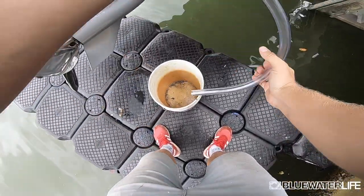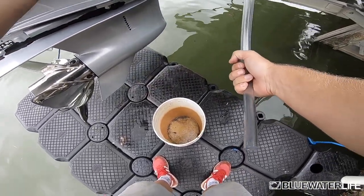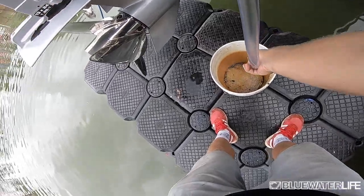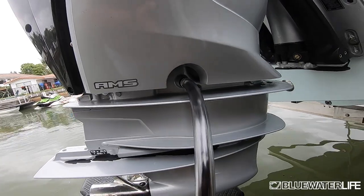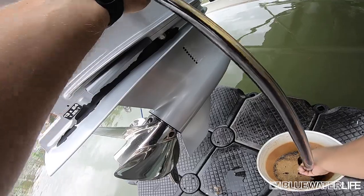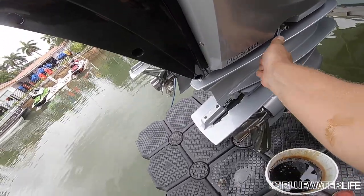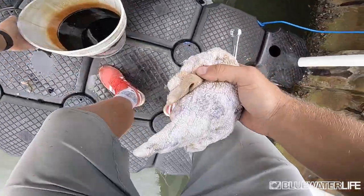It's pretty easy and stays pretty clean. I would still have a towel on you just in case oil spills down the side of the engine a bit — it happened for me just a little bit, but 99% of it got into the bucket. Once it's flowing, it may take a little bit depending on the angle you're at, whether you're on a lift, on the water, or on a trailer. Once all the oil has drained, take that 5/8 wrench and retighten the bolt — don't over-tighten it, but make sure it's tight.